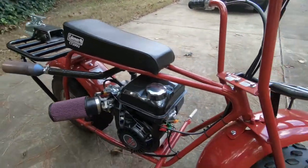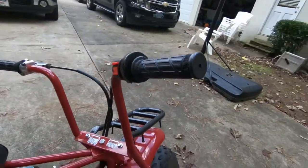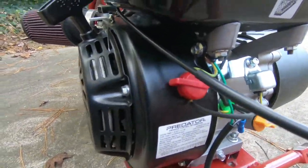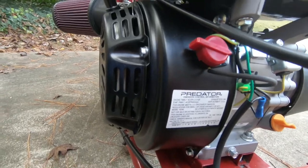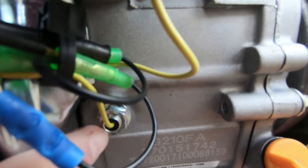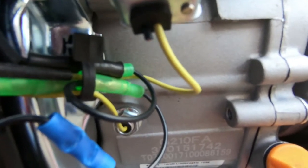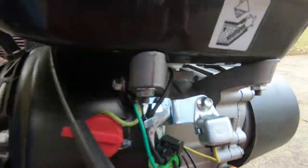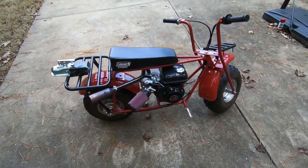The last thing — and this didn't add a new part — I wanted to reuse the kill switch that comes on the bike rather than having to reach down and use the switch on the engine itself. I talked to the guys at Go Power Sports and they suggested wiring the kill switch to the low-oil alert wire, which cuts the engine if you go low on oil but is otherwise rarely triggered. So I wired it up to that and now the existing kill switch works just fine.